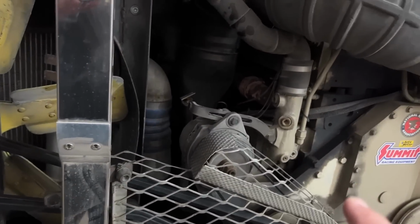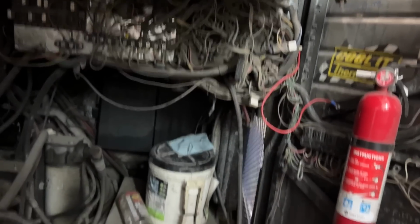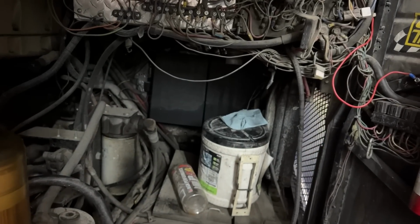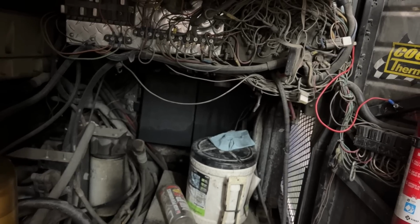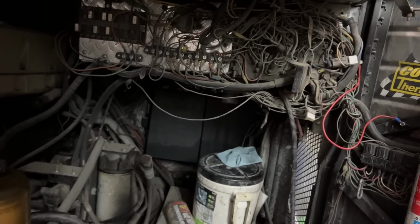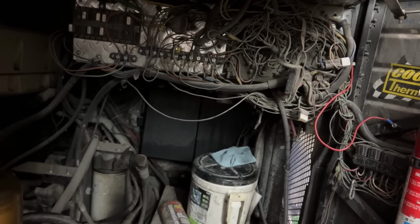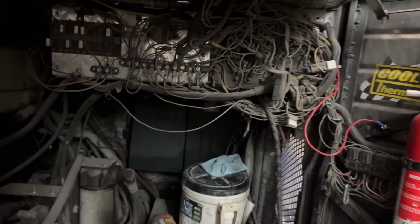We gave them a spare alternator belt. We've changed the oil. We cleaned up the grounds on here. We added a ground to this door. We're having some electrical problems, and we think it's ground related. So by taking off the main ground and cleaning everything on there, and we sprayed some dielectric type cleaner inside some of the connections on his cruise control. His Jakes have been working intermittently, his turn signals have been working intermittently, and his cruise control recently quit. So the Jakes worked. We fixed them when you were here last time, and then the day after he left, they quit working, and then they magically started working again. And then his turn signals will work sometimes and sometimes not work at all. So we're working on it possibly being a ground issue.